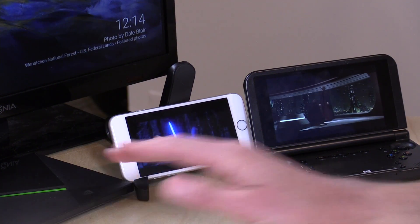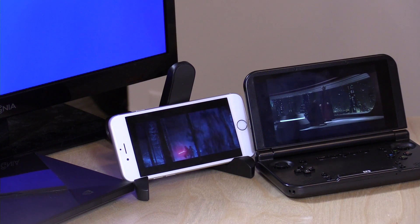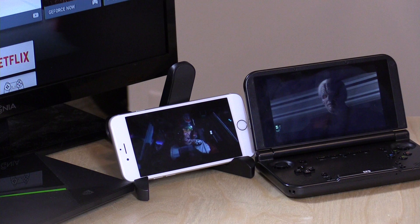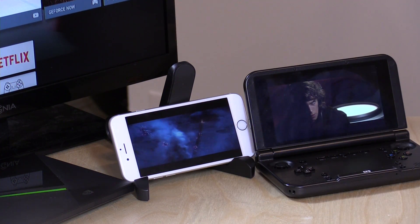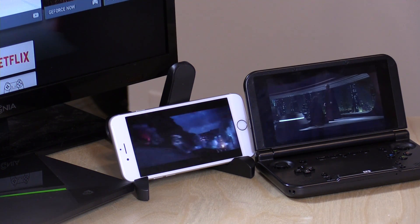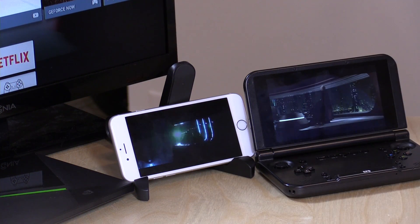You can turn off the Shield and everything will still keep running, because the Shield even when it's off, it's on — it has a standby mode where it does a lot of background tasks. When it's not doing Plex serving, it consumes about six or seven watts of power. Even with the Plex server loaded, as long as it's not sending out transcodes, it will keep its power consumption pretty low — probably less than a PC on your network. I found that when it's running with these two streams going at the same time, it's usually consuming about 17 to 20 watts, so not all that much energy consumption. It may be a good alternative to a PC, especially if you're not serving too many simultaneous streams.